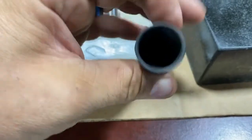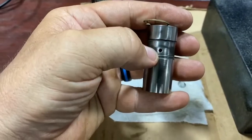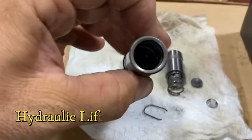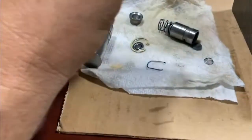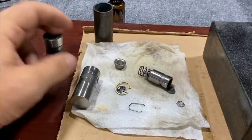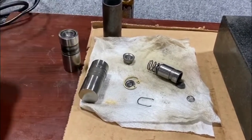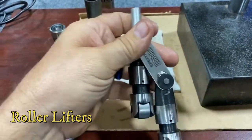Here's one off of a 1947 Buick — it's basically just a tappet, hollow down inside with an oil hole on the side. The NASCAR engine lifter feeds oil through that hole and up through the push rod, and this one does the same thing. But the hydraulic lifter pumps up based on oil pressure, which makes for a quieter valve train. In a race engine you don't need it quiet — it's more precise, the lift is consistent, and you're going to have more power.